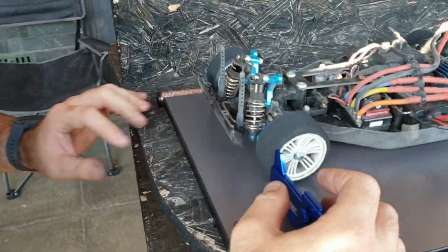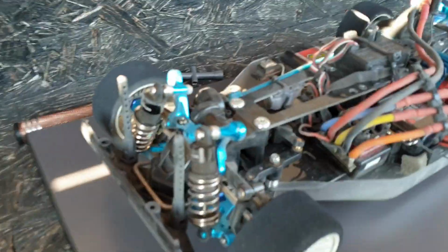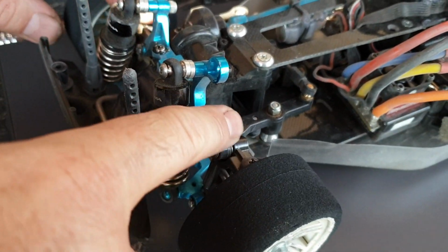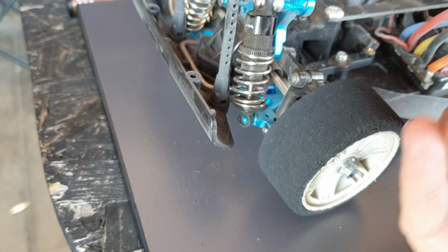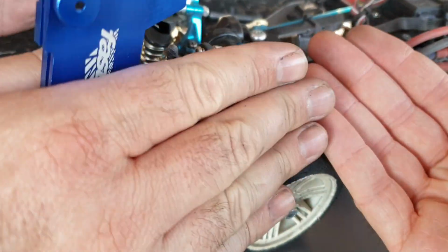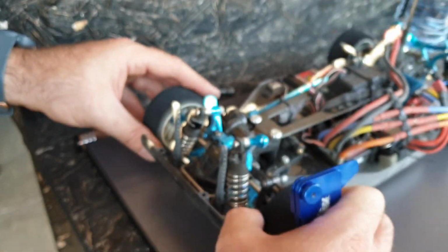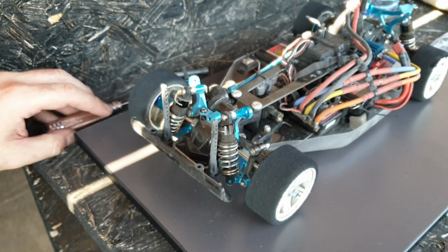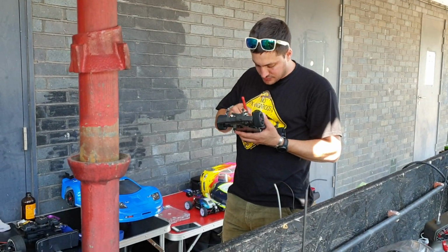Which obviously that isn't, because you can't adjust the camber at the front. So this one, for example, I should have changed it for something. You should have a turnbuckle, yeah. But it should be 2 degrees out, or it should be up 2. So they're going to go like that. It should be 2 degrees. Yeah, that's a good point to start with. 2 degrees is a good starting point for the front. By the way, Lauren says 3.5 at the back for the touring cars, but I think it's too much.